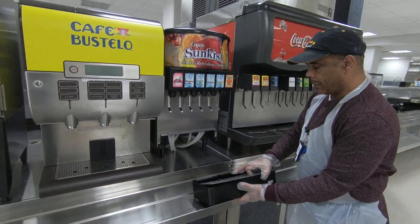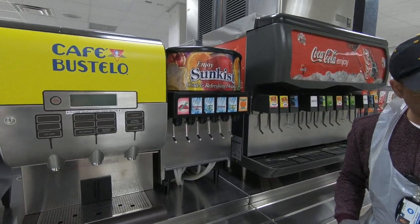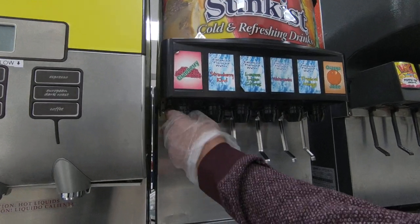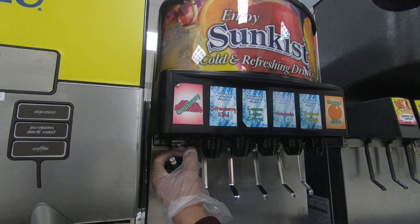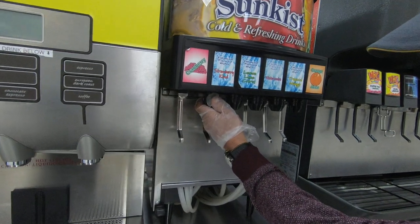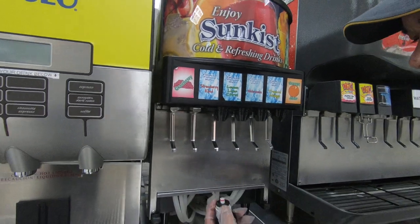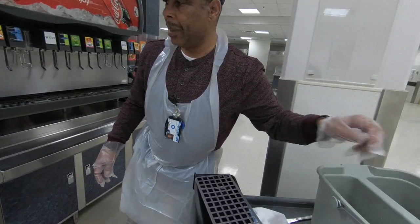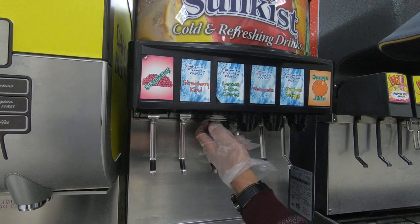Take your grate out and your char. You can use 133 all-purpose cleaner on that, and you're going to remove your nozzles by turning left, then you're going to pull your diffuser out. Sometimes it'll come out with the nozzle, sometimes it won't. So you turn it left and then you pull your diffuser out. You're going to let those soak in plain hot water. No 133 on that — that's a food contact surface.